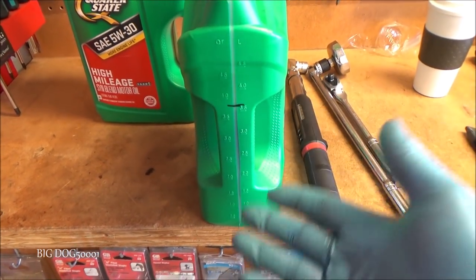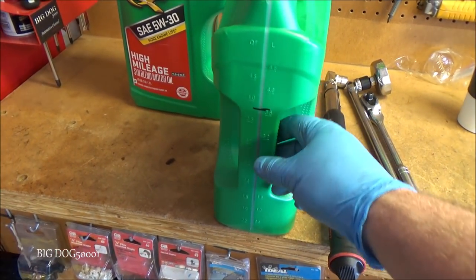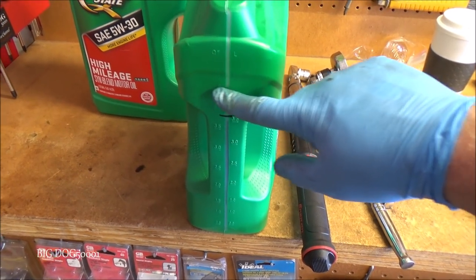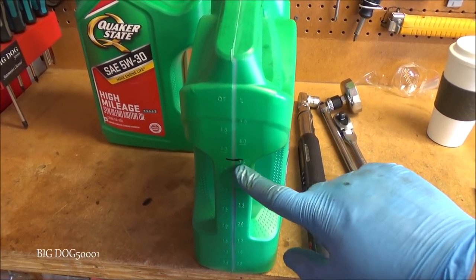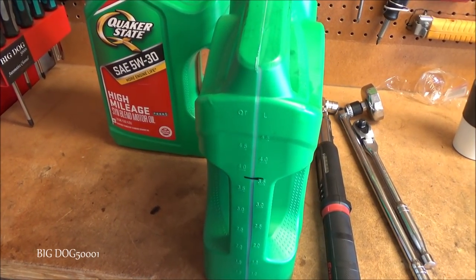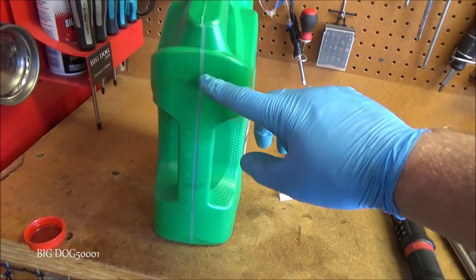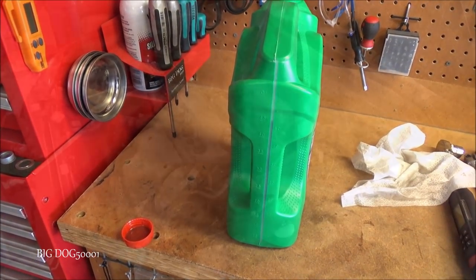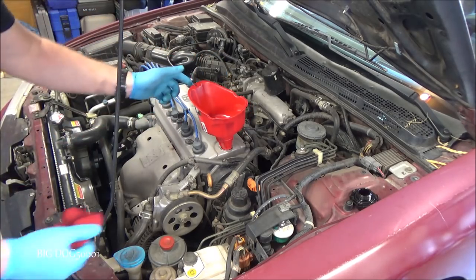It's not a bad idea to check the oil before you drain it to see where your level is. This is the oil that came out — check how much you have against how much should be in there. It should be 4.5 quarts, and right about here — just a hair below where I have this line — that's where the actual level is. So we're about three-quarters of a quart low. I have a clean container with oil pre-measured to exactly 4.5 quarts, so I can just dump the whole thing in without worrying about it.